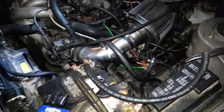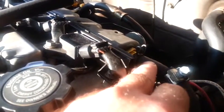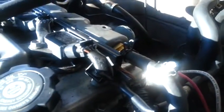It's been weeks of trying, and I finally have a solution. Huzzah! What we have, in essence, is the original tube that I bought that fits rather nicely — 3/8ths. It gets onto your PCV really well; you can even use the original clamp. Works great. Just kind of spread them with your fingers or with a 45-degree plier, and you'll have that taken care of.